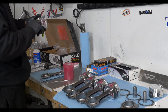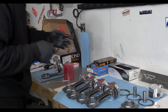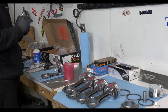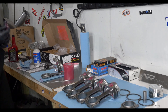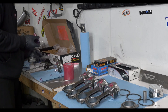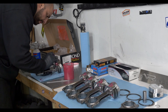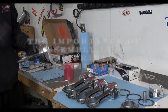In a lot of motors — any motor really — never be shy about this stuff. Pulling that pump apart, polishing it, supporting it, cleaning it up, and priming it. I think skipping that step has messed up a lot of builds. You assemble it and it's got to get up to pressure fast enough.